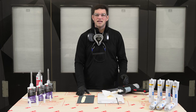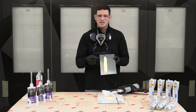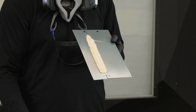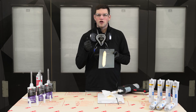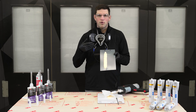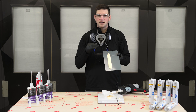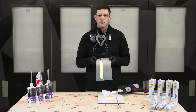So you can see we now have a very nice functionally sealed seam with an appearance bead over the top. Again, we want to follow OEM recommendations — look up that information at the OEM sites where it says to use 2K epoxy primer, and make sure we're using it. We want to clean that surface and apply our seam sealer to get that nice quality joint, fully corrosion protected on the exterior, the interior with cavity wax. And we have a quality repair going down the road.